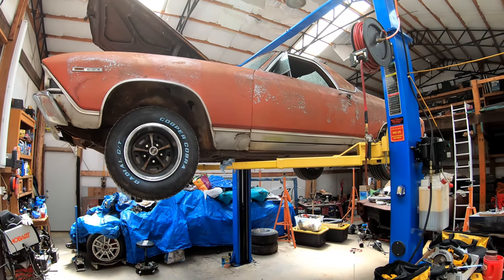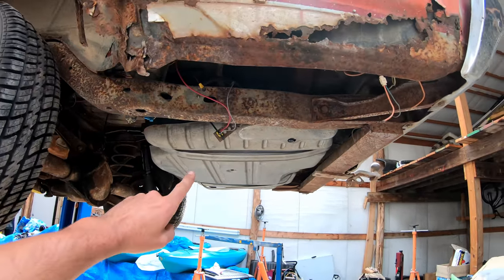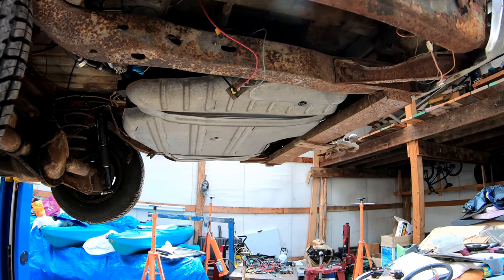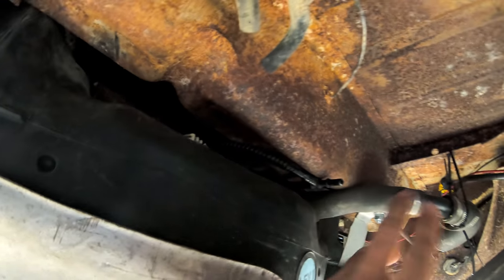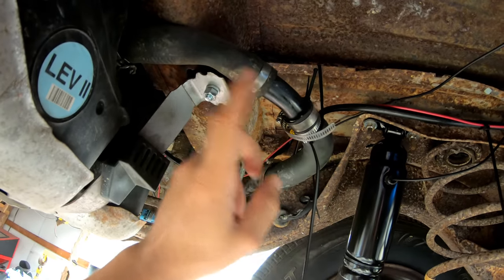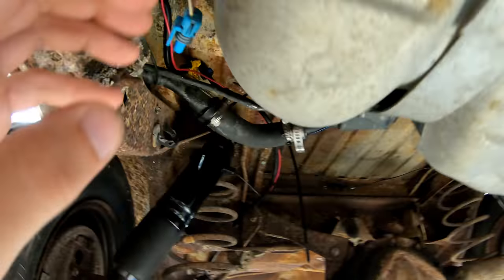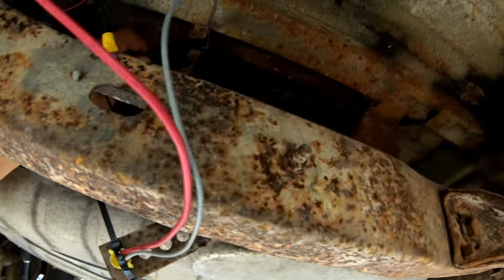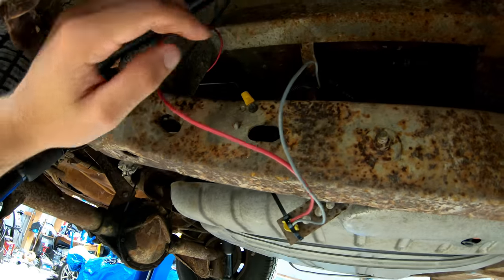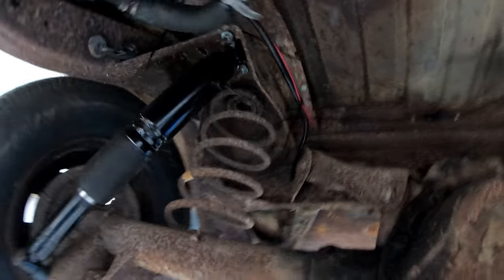Last run through before Power Tour, show you guys what we did and what we'll be running at Power Tour. So this you'll recognize as the blue Pontiac G6 that came in, and we pulled the fuel tank out. Stock fuel pump, stock nylon fuel line here, and then Pontiac G6 filler tube with some bending and some hose going to the factory location. Now coming out of the fuel pump, you have a big wire harness, and the only important wires are gray, which is your power wire, and yep, that's run through a wire nut, and then black ground to chassis that powers your fuel pump. So we got that line running all the way up to the front.